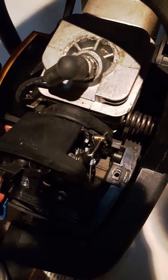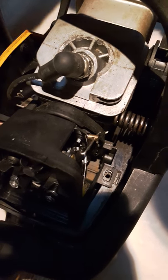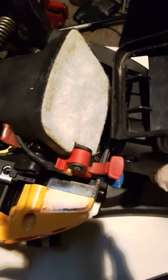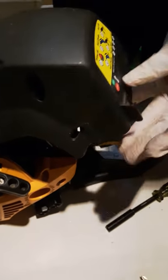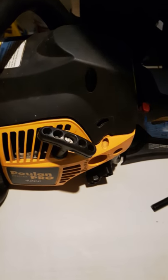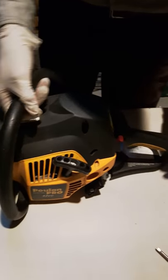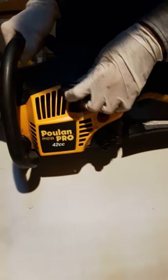Now pull the trigger to see if it works fine, before you close it off. And it will be working fine. Put the filter back in and operate. Make sure this is nice and tight. Put this back in. Now put the cover on, put some gas mix — this one is 40 to 1 — and we will start it up.